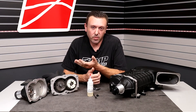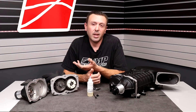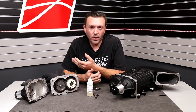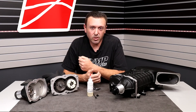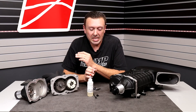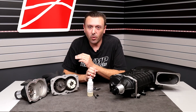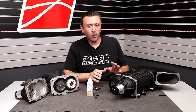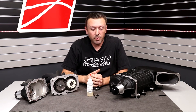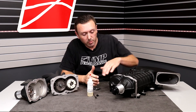The original VMP Gen 3, Gen 2, and Gen 2R superchargers came with 6 ounces of oil, and then that went down to about 5.5 ounces. So if you do manage to overfill your supercharger a little bit, not a problem — don't sweat over it. However, never try to fill it to the top or the fill hole. Or even worse: we had one person stand the supercharger up and fill it with oil until it came out. That's a bad, bad day — it actually boiled the whole front nose drive and everything, and that was the end of that supercharger. You're going to have a bad time.